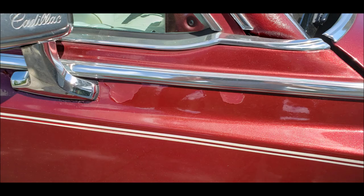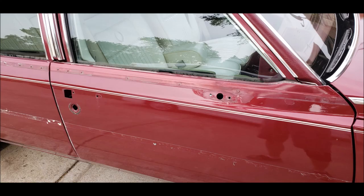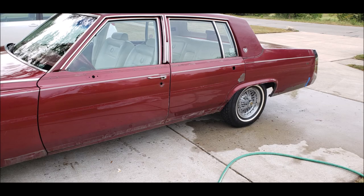By now you're left with the door trim. The chromed spears that follow the hood spears are held in place by clips — no screws at all — and they can be removed using the upholstery trim tool. The only way to remove the door handles, locks, weather stripping, and mirrors is to take the interior door panels and glass out of the doors. That includes the small quarter glass on the rear doors. You can remove the handles and locks without removing the glass, but the mirrors and the top weather strip cannot be removed without removing the glass. And if you need YouTube University to tell you how to do that, you're probably in over your head and should turn this project over to the professionals.